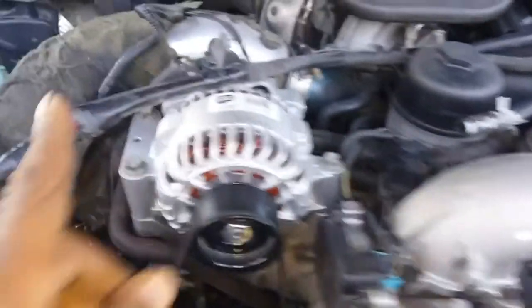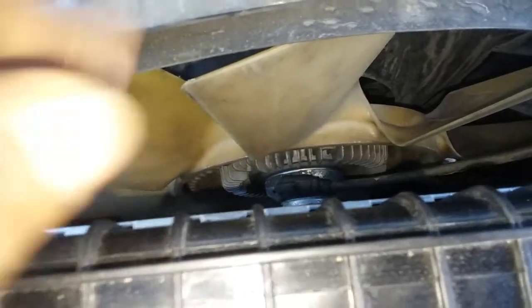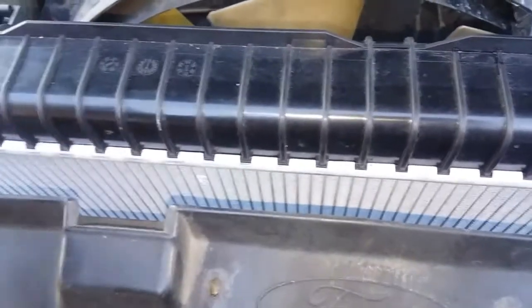When you're putting this back together, make sure before you put the positive cable back — after you put the radiator in, hook up those bottom hoses. The next thing you want to do is put that shroud back in. If you do it any other way, you're going to be doing it over. I almost put the positive cable back and then remembered I need that space to get the shroud back in. Put that shroud back in before you put everything else back together after you get that radiator in.